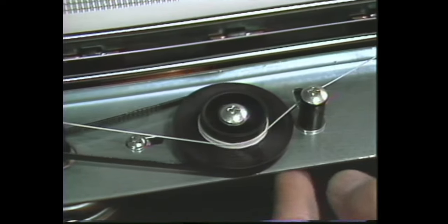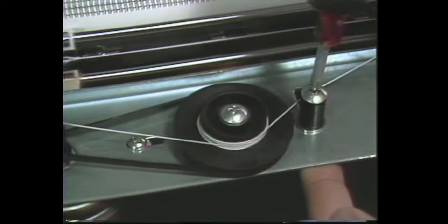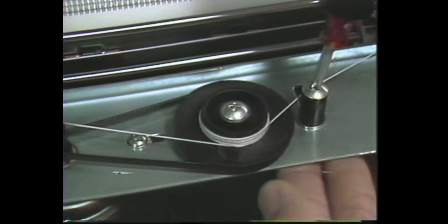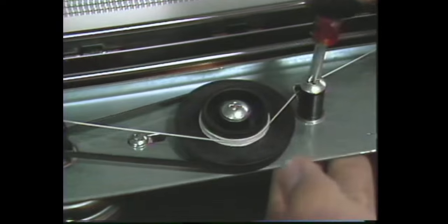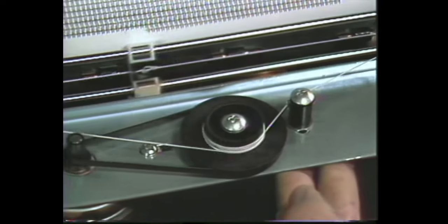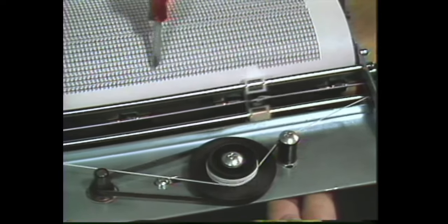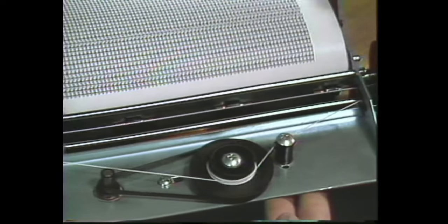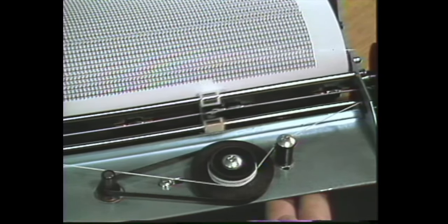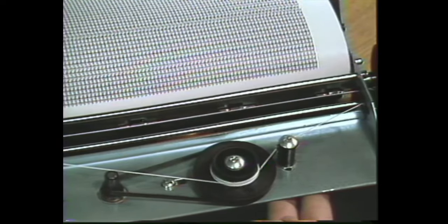Next, we'll make our fine adjustments with this idler post. Since it's still loose, just make sure it's loose, and move it in slightly, then check the pattern that's being printed. What we want to watch for is to see that the little zig-zags straighten out and disappear, also watching the left and right hand margins. We want to let the pattern print four, five, maybe six lines before making another adjustment, just to see how the adjustment settles.